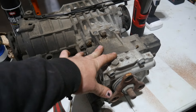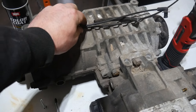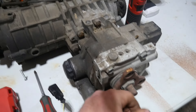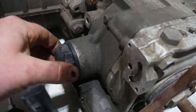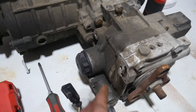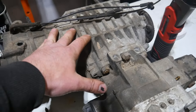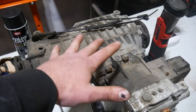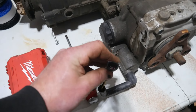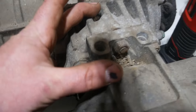So these are just the breather hoses, and then your axles obviously bolt there and there — this isn't your typical rear end setup. You can see where the drive shaft bolts on, and then this is like a little oil filter for the Haldex fluid. Basically right here is the Haldex unit, and it has a little motor down here. When the ECU tells it that we need all-wheel drive, it will engage the rear wheels because it's a front-bias system. Normally when all-wheel drive is engaged, bone stock with the stock ECU, it's like 70-30. So this system really isn't working too hard, and there's a clutch pack in here.